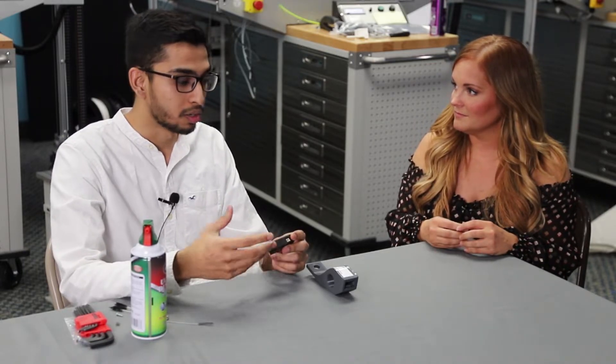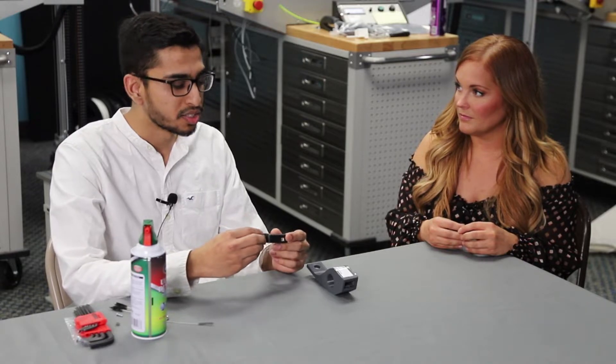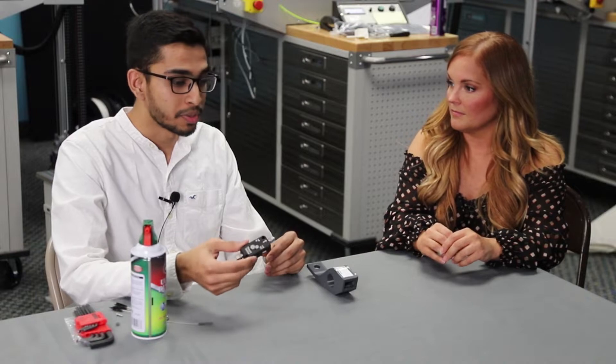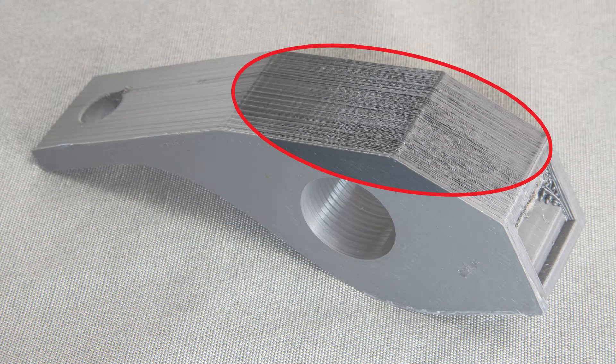So Adnan, what happens? Why does that happen? A major roadblock to an efficient filament feed is that the filament experiences some kind of drag or friction when you're operating it. As we go through various spools of different manufacturers, there's always a possibility that we have some inconsistency in the filament diameter, and it cannot run freely through your filament sensor. Also, depending on where your machine is — in the office or on the shop floor — you may have dust or debris getting into the filament sensor and clogging it. When this gets clogged, either the nozzle gets jammed or you may have a complete part but it looks rough on the surfaces.